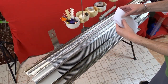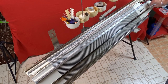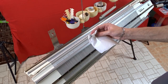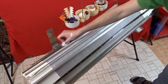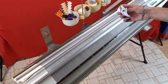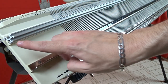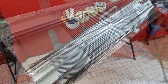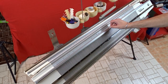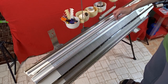Take a paper towel and use it to wipe off the old oil. I use kitchen paper because it doesn't leave any lint after wiping off the surfaces. Wipe off the oil from the rail on the back bed too — you can see how dirty it can get. Now use cotton swabs to clean the other slots on the upper rail. Clean the oil from the lower slot, then clean the upper slot where the edge springs are.